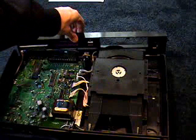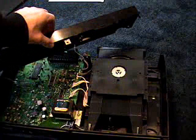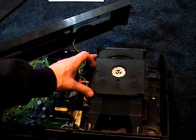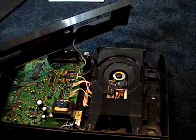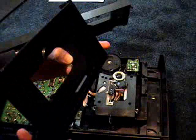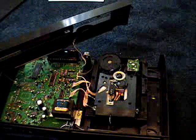I got the face plate off, and the wires are a little short, but it kind of comes out and I can set it like this. This is the magnet that connects to the laser's metal to hold the CD in place, so I'm taking that off. And then this is the actual drawer itself — you see the drawer always has these gear strips on the side, and the gear strip goes along with this gear here, which hopefully, when it turns, opens the door.